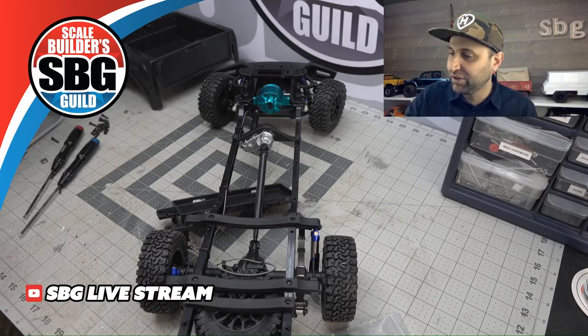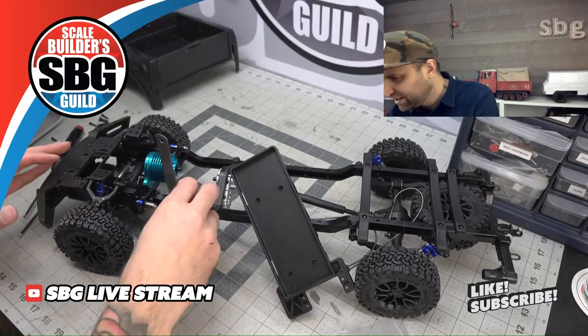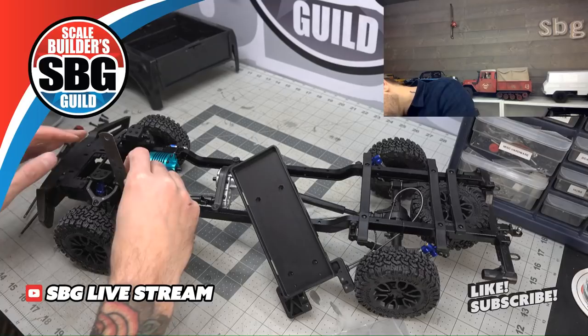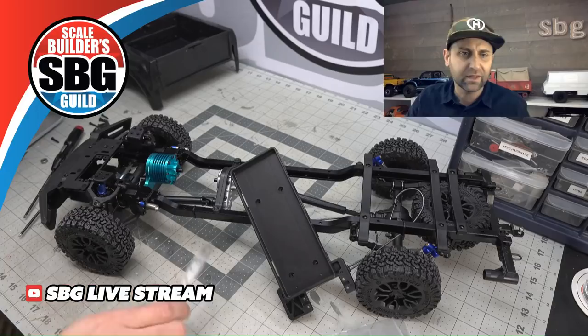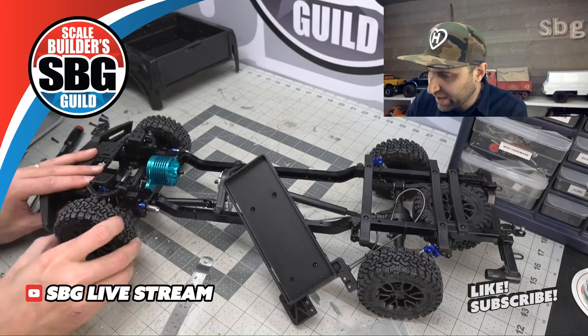How much front travel is there? Let me see if I can get you an accurate measurement on that. I'll get out a ruler. I always have a ruler handy. And we'll see if we can measure the amount of flex from some point here. I'll even do it in inches for you if that helps. So let's say it's like 3 1/4 inches right now. And on full compression, I can get it down to 2 1/4. So there's an inch of travel. Not too bad. It's firm, so you'd have to really get it going. I wouldn't mind actually changing out these springs and making it a little looser. That might help.